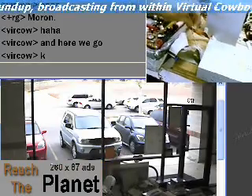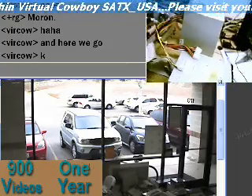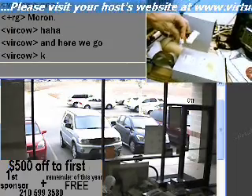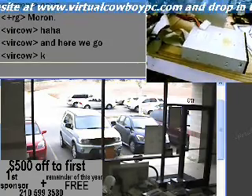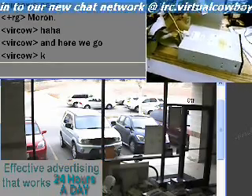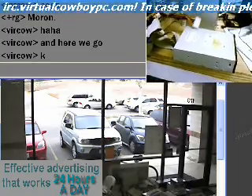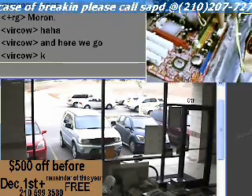So what we do here when we install the power supply, you've got to connect it. There are a couple different cables here that may or may not go to the motherboard. These are the ones for the motherboard. We have a four-pin — these are almost nearly always yellow and black — and this is a separate connector, and then we have a 24-pin. This 24-pin can convert to a 20-pin, and if that is the case, here is your socket right here.